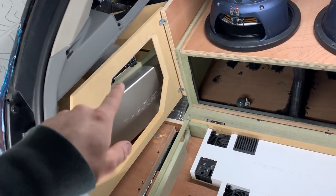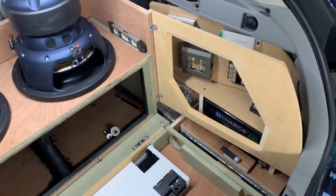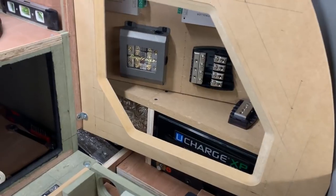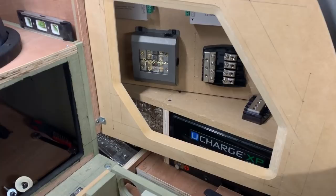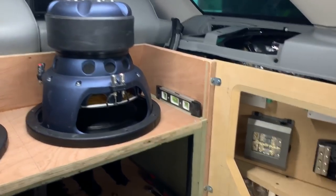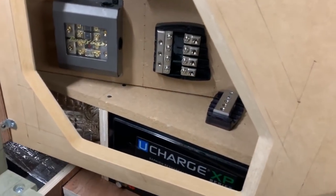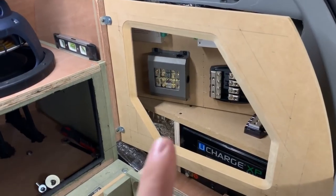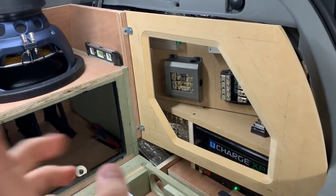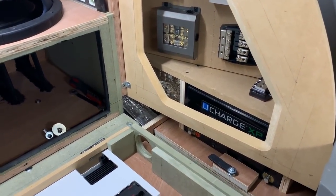On this side there's not going to be direct access to the amp and DSP — you'd have to take the panels out to get to them. But on this side we have to make sure you can easily get to the fuses. Those two fused distribution blocks — it would have been nice to have matching ones, but they were supplied by the client. That Phoenix Gold piece wasn't used before, but he had it and it's a beautiful piece — and just like the subs, that brand is very close to his heart. There are also two LED controllers over there with an earth block. We have to have access to those in a really short time according to the rules, so I'm going to make a window frame so that panel — which will have perspex behind the cutout — can come out easily and you can get to the fuses.